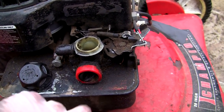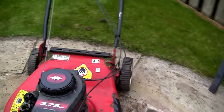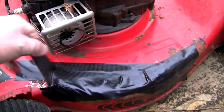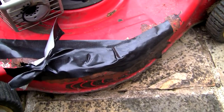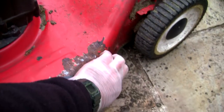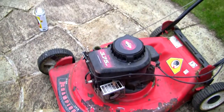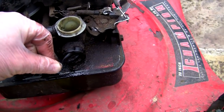So if I can replace this primer bulb and clean all this up, I think I can probably sell this — but it all depends what's under this bit of tape here. If there's a massive hole in it, it's going to be a difficult sell. You get a lot of people who just want one of these to get them through a cutting season — you'd be surprised. That deck is well and truly rotted — no good at all. I'll have to think about what to do, but I'm certainly not going to spend time repairing that. So it starts and runs — I've either got some parts or a lawnmower. This primer bulb is well and truly gone — it's all split.